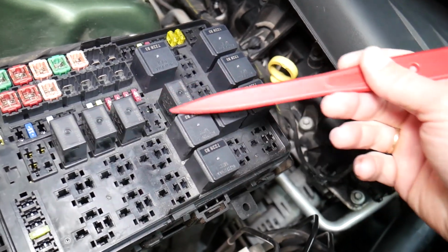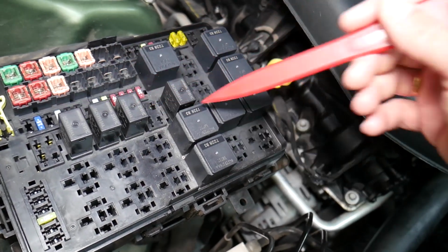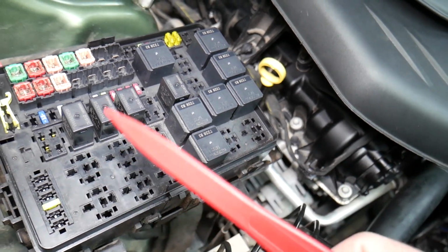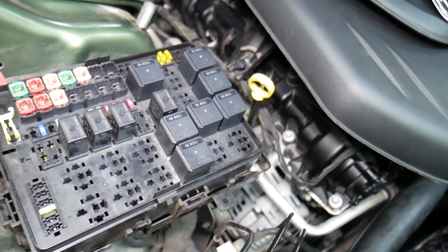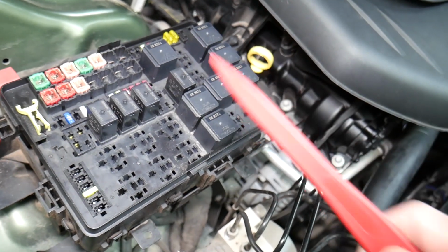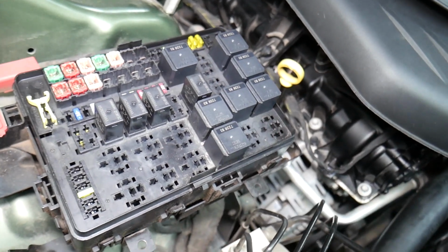The same thing for relays, okay? Some of those could be really expensive on cars, so we'll put a link in the description of the video below on how you can test relays. And for some certain fuses, it's important to disconnect the car battery when removing them, otherwise you can burn the electronics. For instance, when working on airbag fuses or anything like that, you need to wait at least 1 hour after disconnecting the car battery, and if you're not qualified and certified to work on the airbag system, I will never recommend doing that.